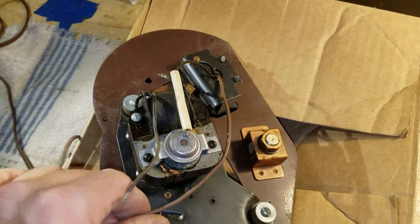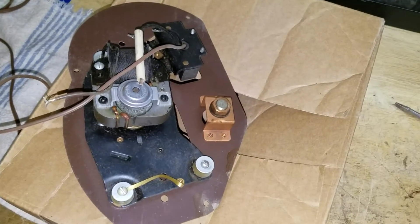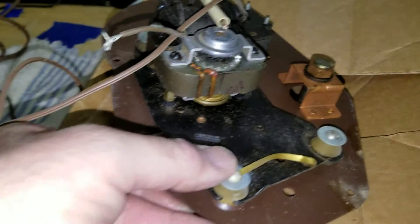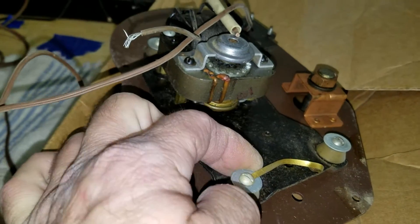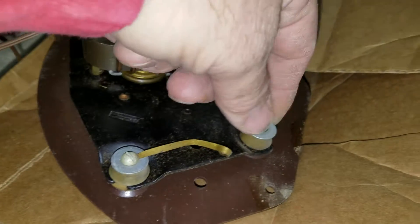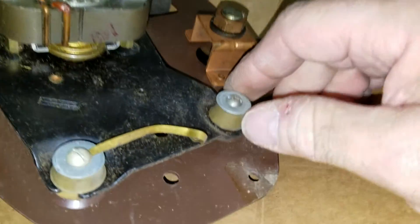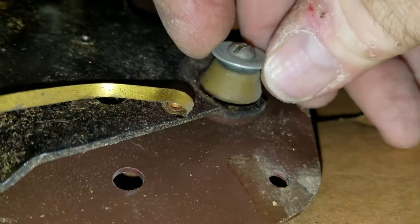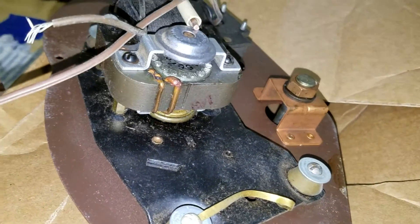I don't think I've ever seen one in this condition before, but that will make it easy to work on. The motor doesn't look too bad — it looks fairly clean. I'm looking at these grommets, these suspension mounts, and they actually feel pretty good. The idea is that these need to be soft and cushiony without breaking down. These look to be in really good shape, so I don't think there's any point in replacing those. This is going to be more just a take apart, clean, lubricate, put back together sort of thing.